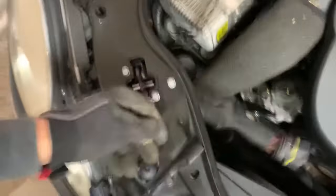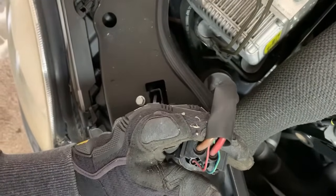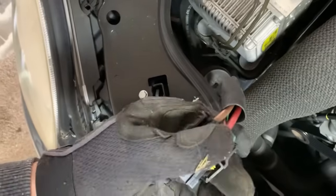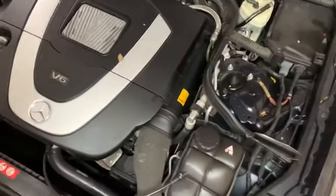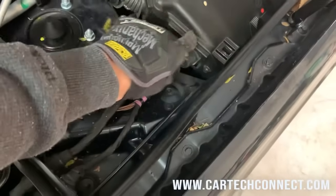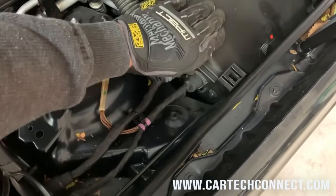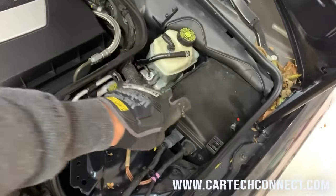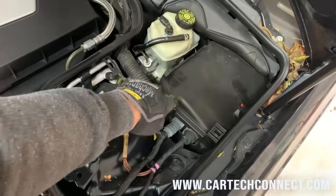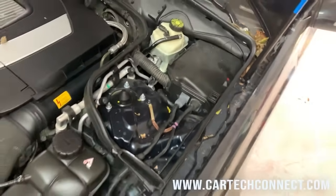It's almost the same for all Mercedes fans. One thing we're going to check for is corrosion in the wires — take a closer look, see if any wiring is damaged anywhere. One thing I did already notice is that the front fuse box is a little loose. Any Mercedes with a loose fuse box cover, water can run right into the SAM. So I'm going to take that up and see how it looks in there, and hope for the best for the customer.